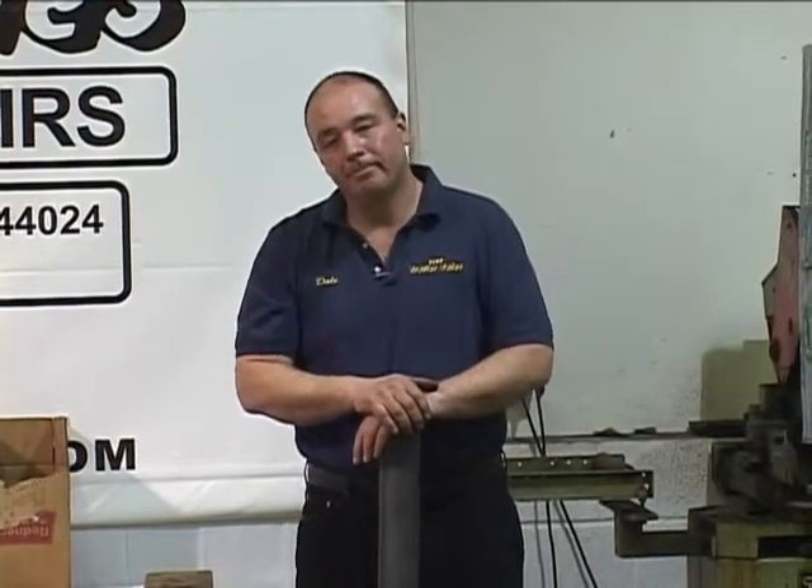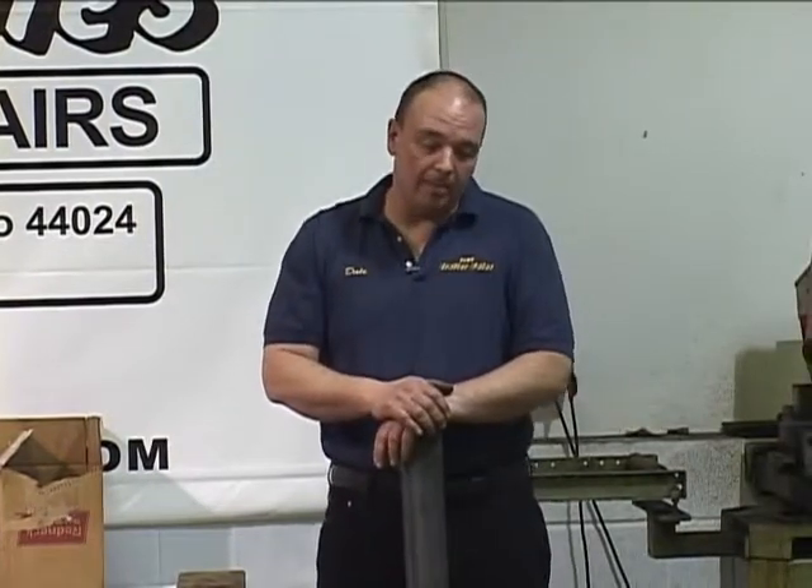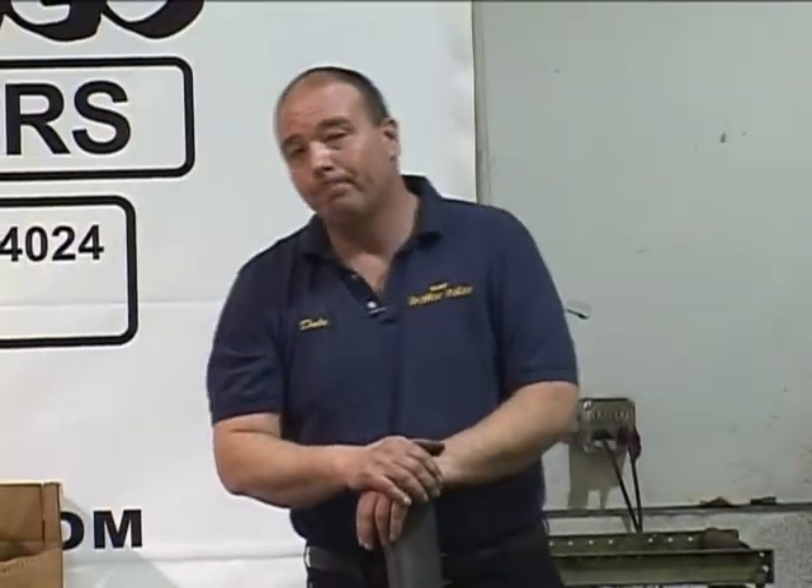Back to the plug — can you use electric contact spray instead of grease? Yes, you can, but be careful to make sure there's no graphite in that type of spray, because graphite will carry continuity. Some penetrating lubricant manufacturers do put graphite in them — graphite is like a lead pencil, and it can carry continuity and make your lights go a little bit crazy. Dielectric grease is the preferred solution.